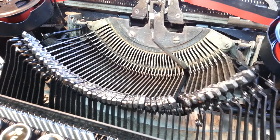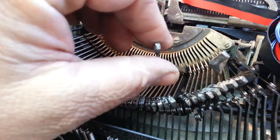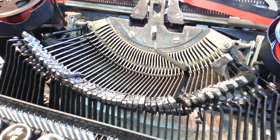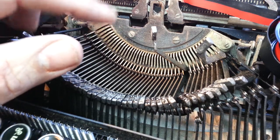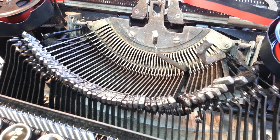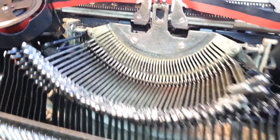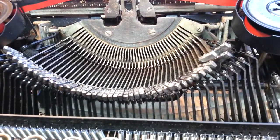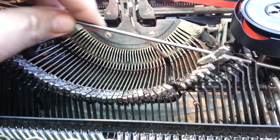What I'm going to try to do is see if I can get lucky and just heat this up and re-solder it by just heating it up some, and hopefully the solder will grab it. If I heat it up too much, what's going to happen is that typeface is just going to slide right off, and I'll have to do a complete re-solder alignment. So I'm going to hope I can just heat it up enough and maybe add a little extra solder right up here to the top, and see if I can get that to stay in place without any further alignment. This is going to take a little bit of luck, but you've got to start somewhere.